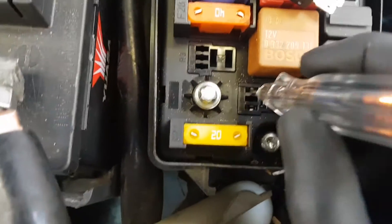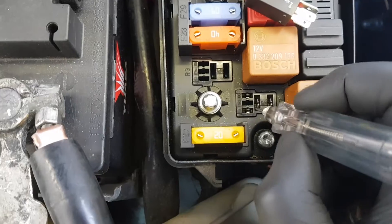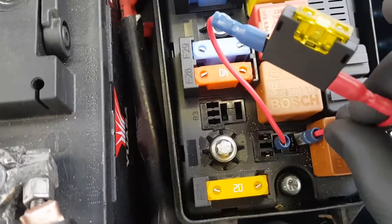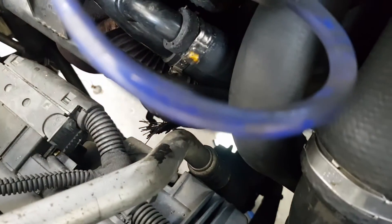On the control side we've got a live, and on the component side we've got a live. Looking at this, the bigger terminals are usually the ones that go down to the component. So I've just wired up a bulb there. If I get this put in and jump this fuse jumper - can we see it? The bulb's glowing down there. So we'll move on.